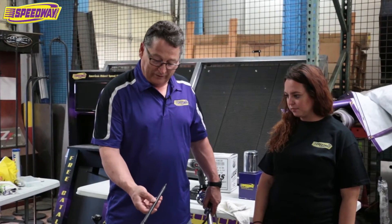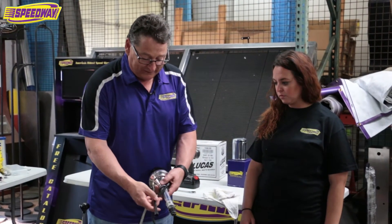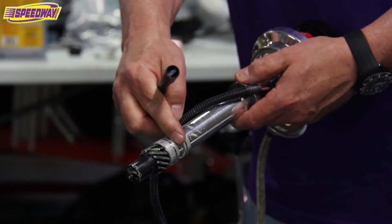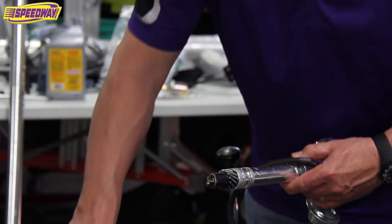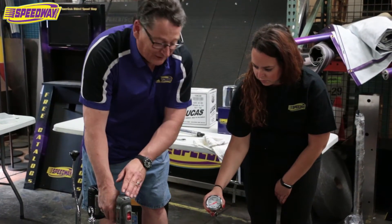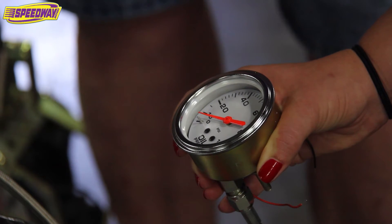This is one of the very first priming tools. It's got the slot to go down onto your oil pump, but the problem with it is you would want to take an early style distributor and cut this off. This seals an oil passage. By using this tool, you're going to get oil pressure, but you'll only get oil to one side of the motor, which we'll show you. We're using the old style primer without anything to close. You also want to make sure your drill is rotating the correct direction. And you can see we're getting very little pressure with this style of primer.